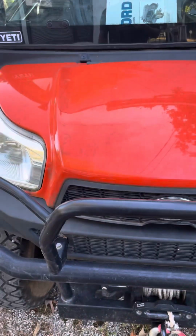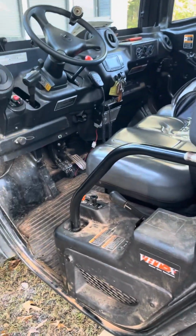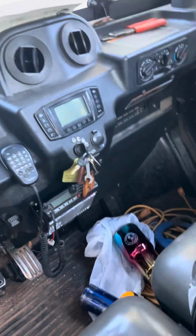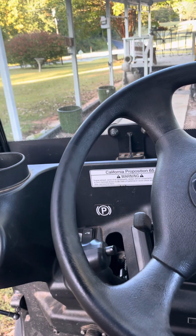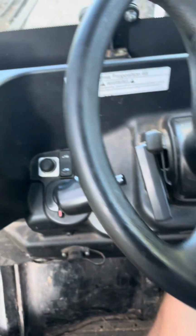Like I say, some folks might be interested in this, some folks might not be, but we'll start from what you need to do first before you see what's under the hood. So I found the easiest way if you're wanting to do a horn upgrade, as the title says. First thing you want to do is take the 10 amp fuse and put, I think I put a 15 or a 20 amp in line. The next thing you want to do, but I tried using the stock horn switch, that didn't work.